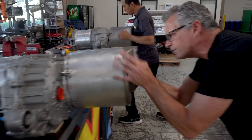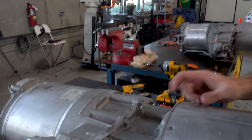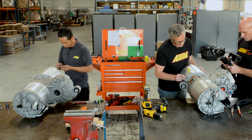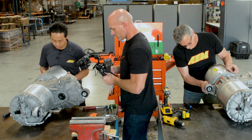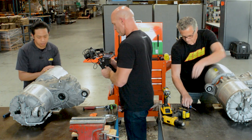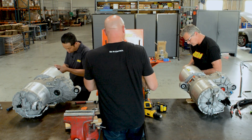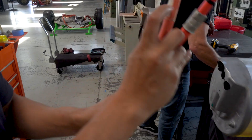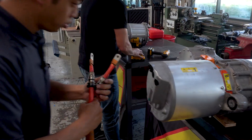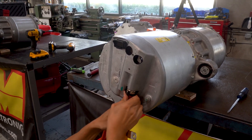You can help guide it through — you don't have to let it come through on its own. Rotate just a little bit until your indicators are lined up and all your Torx holes are aligned. Put a couple of these screws in, then put the small screws at the other end in. Make sure that seal is there and not lifting anywhere. It shouldn't take any force — just give it a little nudge. Check the connector is coming through the hole properly, then give it a good push. Be careful not to over-tighten these — it's a steel or stainless screw into a plastic connector and over-tightening will strip it. There's a clear sleeve on the positive cable that goes to the B-plus side, and an O-ring here — gently work that in and try not to damage the O-ring.